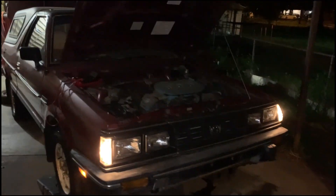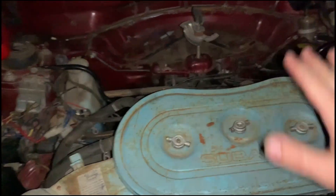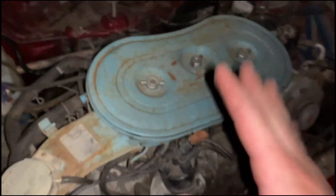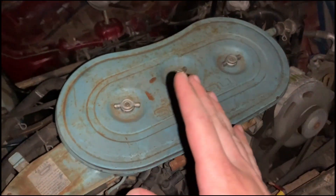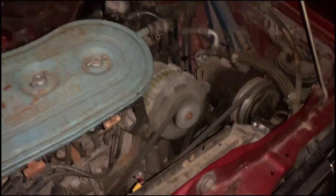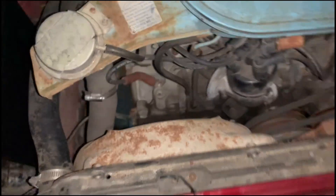Just want to go over all we've discovered tonight — a lot of good things. The entire fuel and carb system works. I've adjusted the idle a little bit now that it's hot and it's idling great. No more real stumble at idle either on the throttle transition. Got some kind of noise coming either from the water pump or the alternator — I'm leaning towards the water pump but I'll have to pull the belt off and figure it out. The fan kicks off and on on its own exactly like it should — that's doing great and it's holding temp. It's been running for probably almost an hour or so.